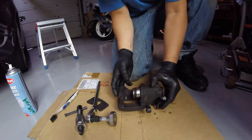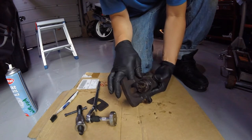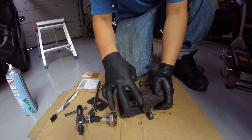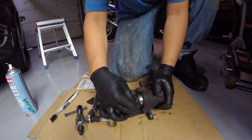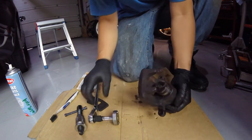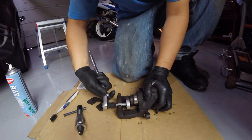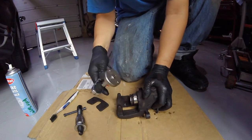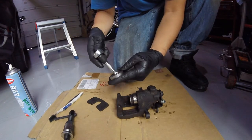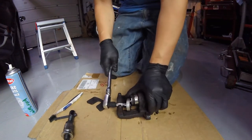The next thing is we need to get this piston out. This should have a protective boot on it, but that got ripped off a long time ago — it's meant to stop it from holding moisture in against this piston. You can see it's heavily corroded where the lip of the boot should sit. I've got a piston rewind tool which comes in 3/8 drive so I can put it onto this ratchet and try and unwind this piston.